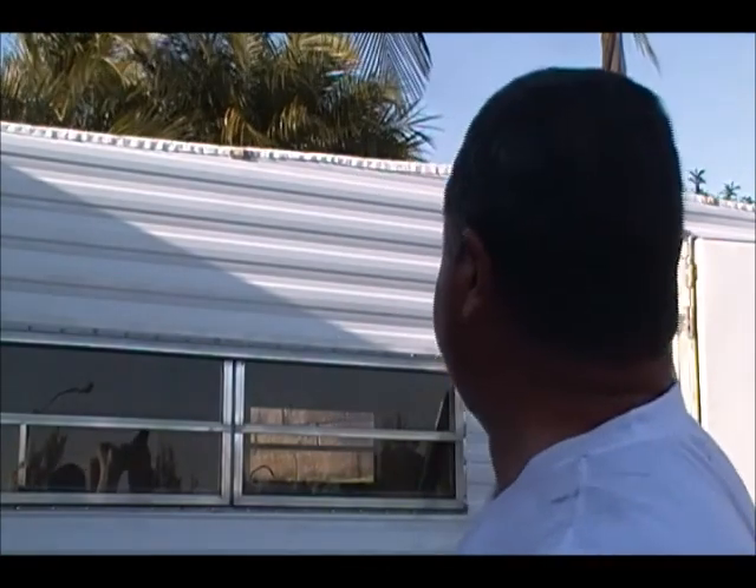You guys know that these old vintage trailers - water is probably the biggest enemy they have. Moisture gets in, sets up in the wood, rot starts to happen and that's when you start getting loose this, loose that, screws backing out, nails backing out, staples backing out, things falling off. So you have to take care of it and seal it up. What I've done is marked up there - took a measurement and put a little mark with a black marker. It'll be covered up so it won't be seen. The rail is exactly 12 feet long so I put a mark at 6 feet, right in the middle.